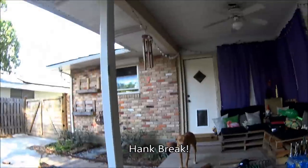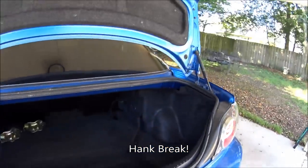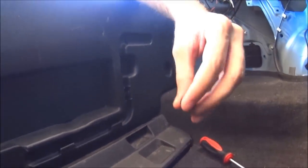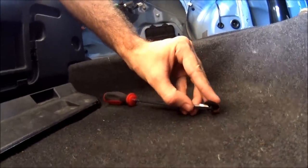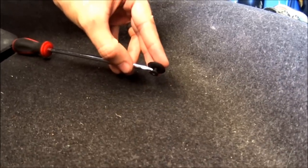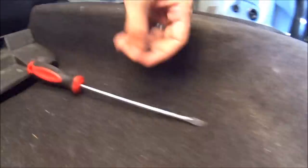Now onto the back. For dismantling the rear, come inside the trunk — on this panel right here you've got these little pop rivets. Basically pry up on there with a flathead screwdriver. They'll be depressed down so you just pry back on it. Get the middle part up first and then pop the whole thing out. There are going to be four different holes. Once you've got those off, you can just lift this whole thing up, pull it out, and put it off to the side.